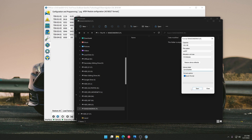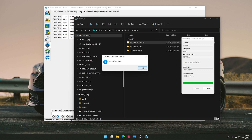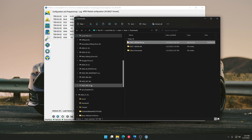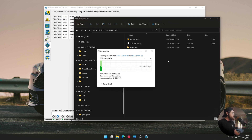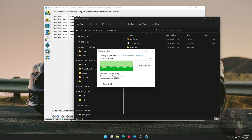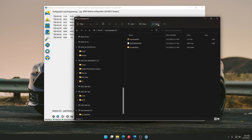We can just do a quick format and click OK. Now we can close this, go into our Sync 2 Update USB, and we're going to Ctrl-V and paste those files onto our USB thumb drive. This should take only about 30 seconds if you're on a quick computer and your thumb drive is USB 3.0. Now we're just going to eject this drive and remove the thumb drive.